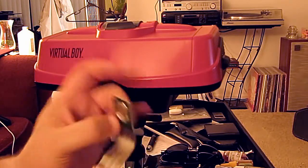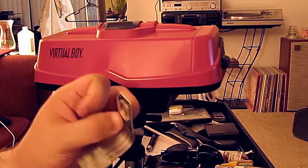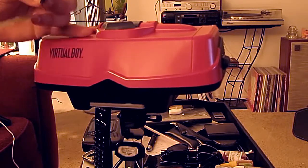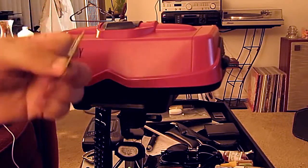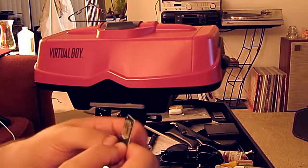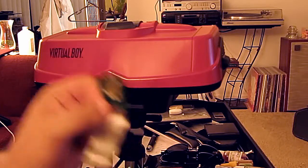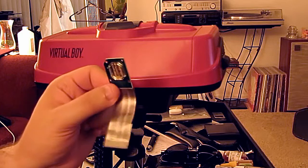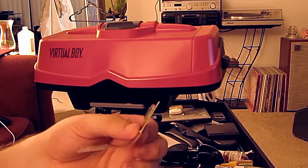There's two screws keeping those PCB boards in place. Once those are unscrewed, all you have to do is detach the ribbon cable and it comes completely free. There should be a white tab attached to the end of the ribbon cable. There's no clamp to remove. All you gotta do is slide it out. I would, however, recommend that if you're not having problems with one side, to leave it alone.